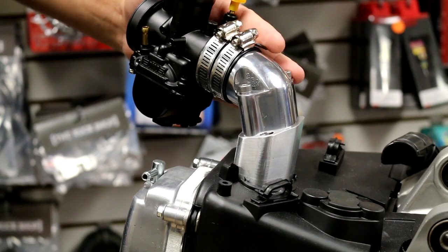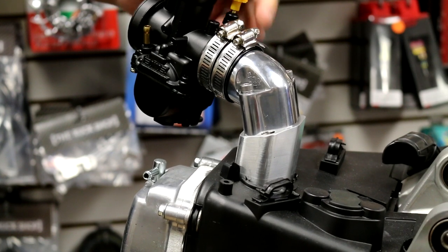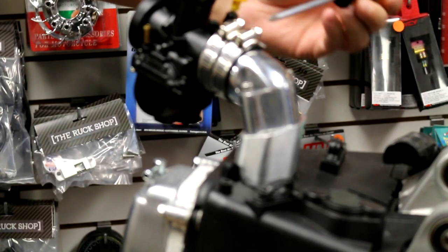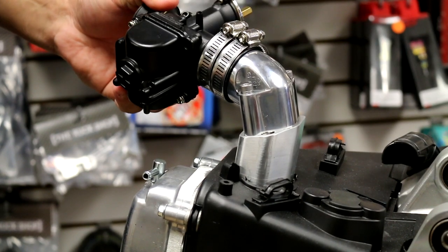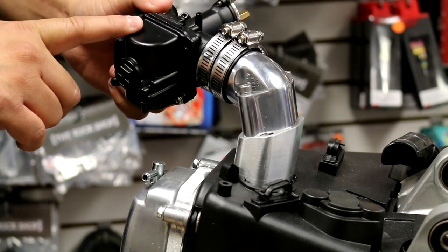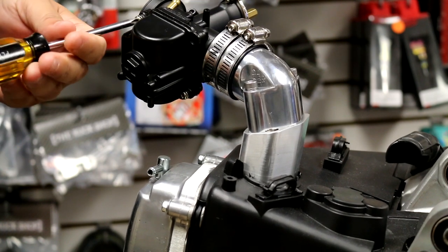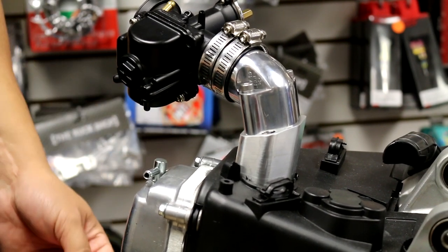Imagine this engine on your scooter — you're not going to want to take off the throttle and take this off each time. So what we recommend is you loosen up your clamps and then you're going to turn this. Once you turn this, you're going to have fuel in here. You can crack this open if you want, but what we like to do is once you open this up, it's going to have air in it and it's going to drip out. You can put a little tube in here as a catch can.